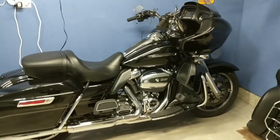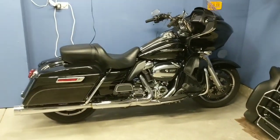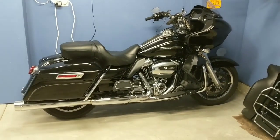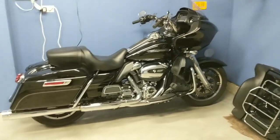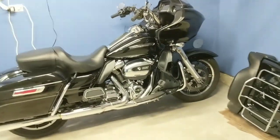Also, with that stabilizer, you are going to want to run the bike for 5 to 10 minutes, maybe take it for a short, quick ride, just to get it through the injectors, through the fuel system, and through the tank. So that's really the only thing you need to do fluid related: just top off the fuel tank and put fuel stabilizer in it.